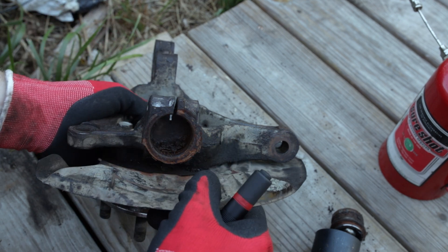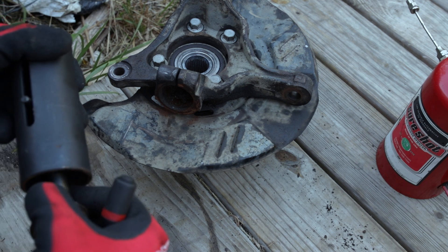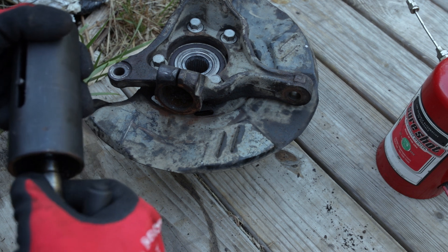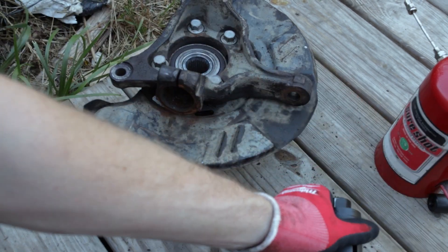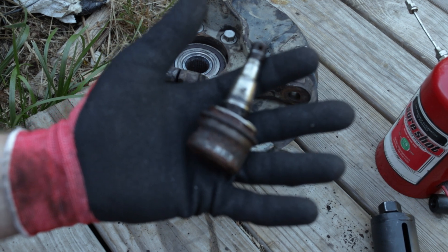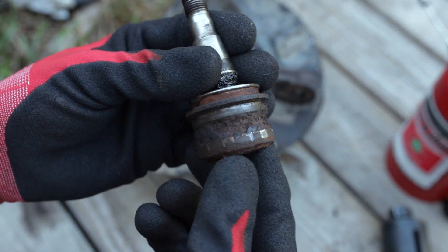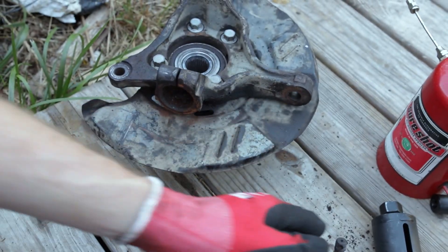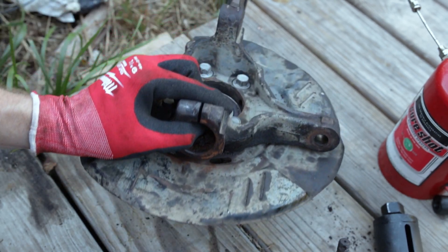The old way I normally do it is I usually take a pry bar, leave the ball joint bolted into the control arm, take the pinch bolt out, and start prying and hammering on it and hope I get it loose. But this one probably would have given me a run for my money. There you can see how rusty and crusty and just disgusting that ball joint was — really well stuck in that spindle. It's a really common issue on northern Subarus, just due to road conditions and the way it's press-fit in there with the pinch bolt — it gets locked in there with corrosion over the years.